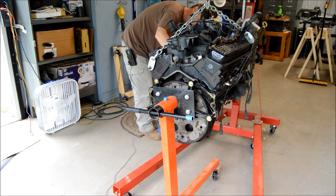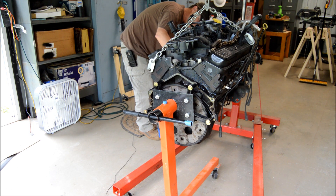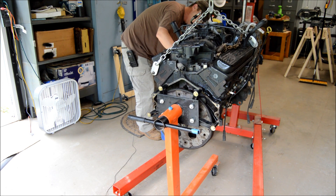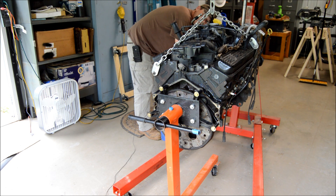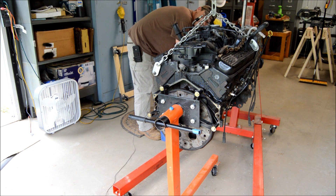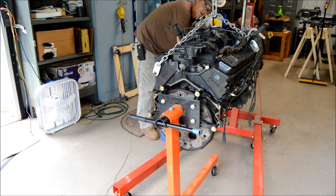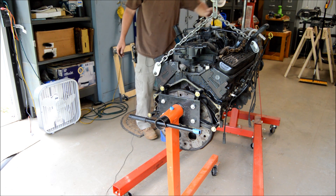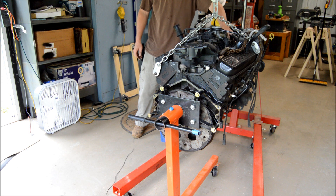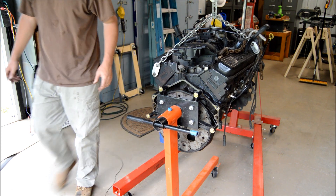Now we're going to have a little bit of protection. Almost there — almost got three wheels on the ground. Going really slow and careful. Now if three wheels are touching, I'm going to slowly let some of the tension off of this cherry picker. I saw the line go a little slack there — go a little more. We're going to leave it like that for a few minutes and let everything settle in. We're going to give it some bounce tests and different things to make sure that when we're working on this engine, there's no possible way it's going to break and snap and fall over on us, because you don't want to get crippled.